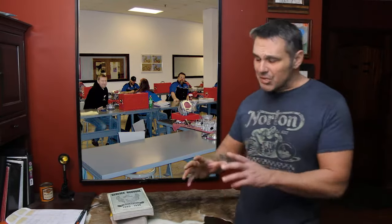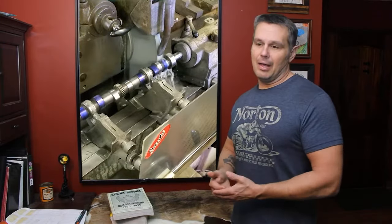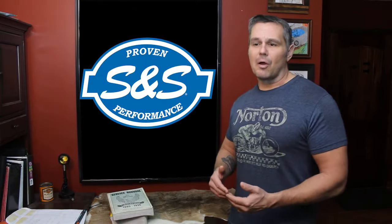So what you've got to realize is the manufacturers, when they grind a cam, they're going to do a dyno, and they're going to have a dyno graph, and typically they put it on their webpage beside the listing. Not all of them do. I don't think S&S does, but you can always go to some kind of cam shootout, or somebody's done a dynograph, Fuel Moto, somebody comparing the different camshafts, and you'll be able to look at the graph.